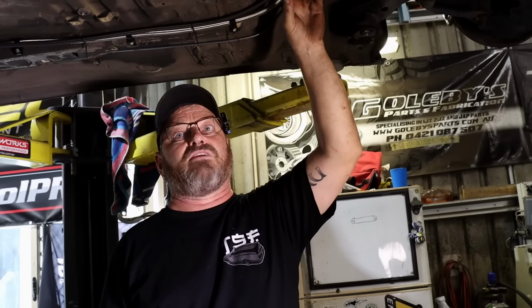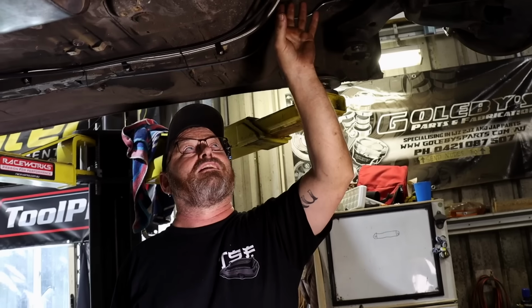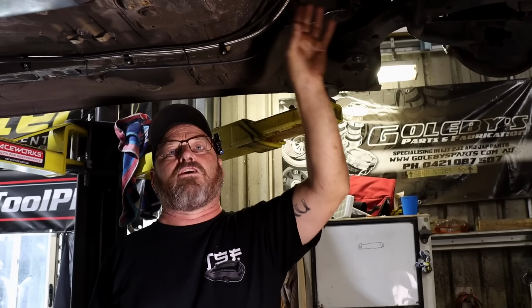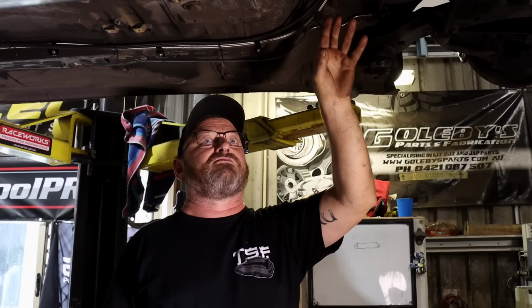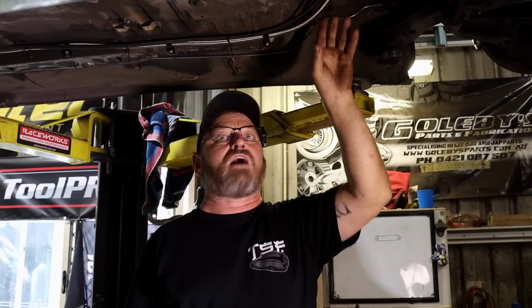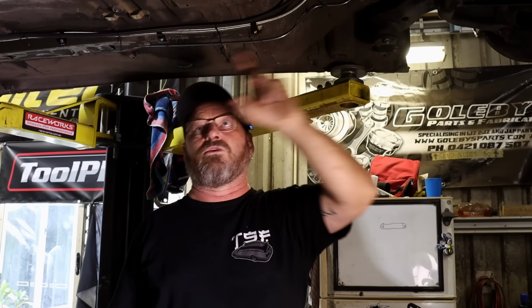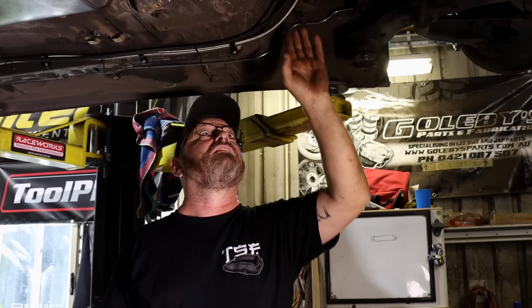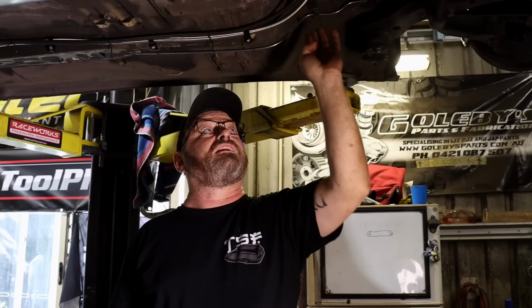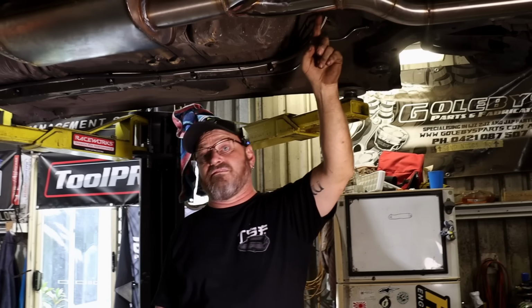A lot of cars do run fuel lines inside the car, so it's not unusual for that. You just don't know about it because they're underneath the carpet and hidden. And my observations of that is, yes, they do that, but they never have a join inside the car. It's always solid. So it's doable, but just probably keep that in mind. Dash 8, dash 6 return. That's going to go back into the tank as well.